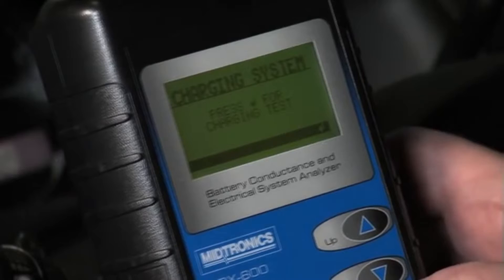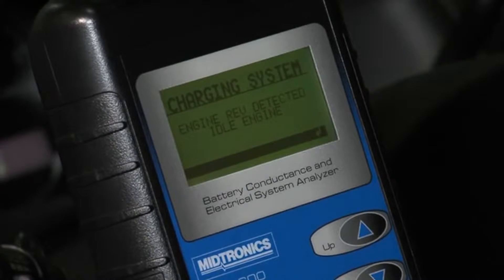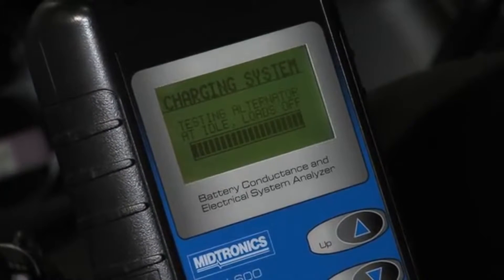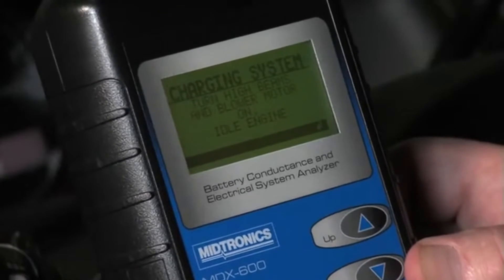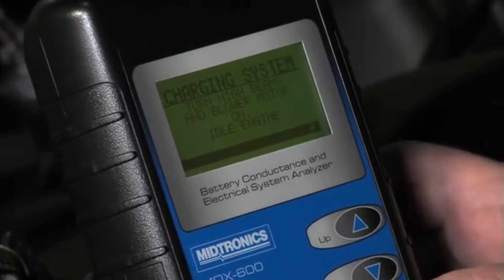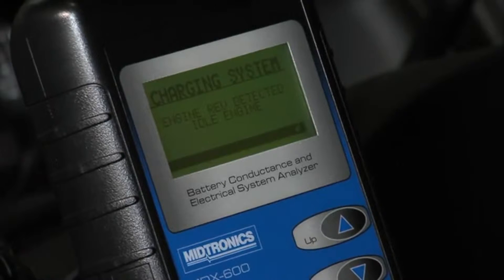Let's hit enter again and go on to the alternator test. Checking for alternator output — now it's going to ask you to rev the engine. We're going to see an increase with the ripple coming off the alternator; that's what that graph is showing. Rev detected. Still at idle. These are all stable loads — you don't want to run the windshield wipers, you don't want to scuff a dry windshield. Moving on to the next section of the test, checking the alternator at idle with loads on. Rev the engine. Engine rev detected.